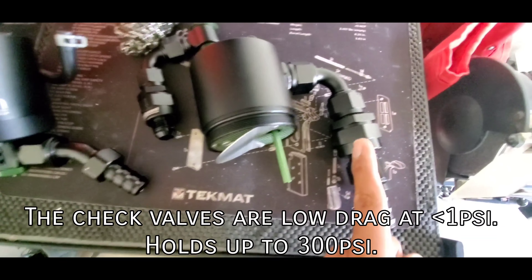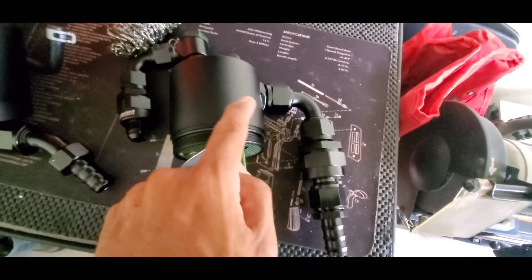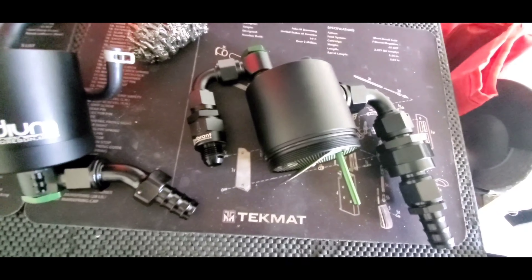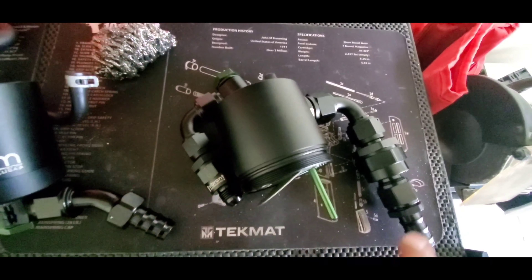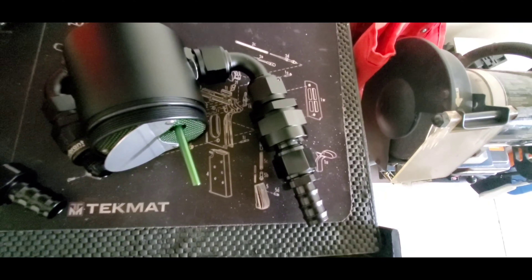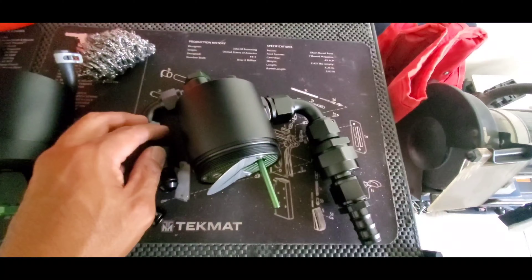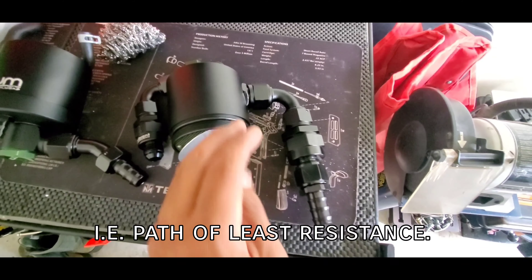The valve opens this side and closes that side, so outside air won't come in and interrupt the air-fuel mixture. I've already tested that multiple times. With this side being restrictive — and vacuum is produced by restriction — at the initial suction it will close everything and draw gases from the crankcase upward. At idle or low loads there's not enough vacuum generated to suck anything on this side, so majority of flow at low loads or idle will exit to atmosphere.